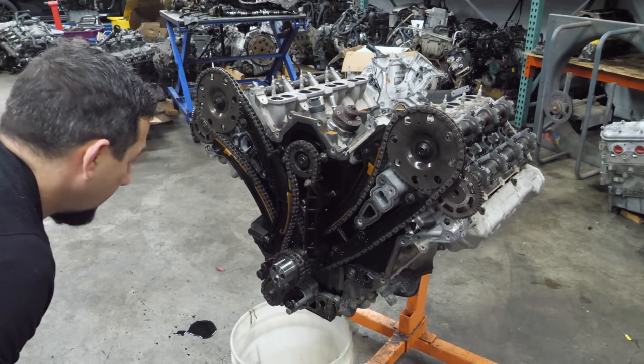There are two bolts left and one rod. I may not have enough throw for this. Well, that's going to be tricky. Maybe I can go through the bore — let's investigate. There's one rod cap bolt and I'll access it from inside the bore. We have definitely done this on the channel before with success. Got the pop out — now all I've got to do is break that cap loose. Almost dropped it; I had my other hand there, otherwise it would have landed inside the block.